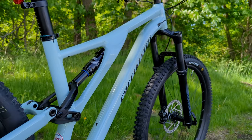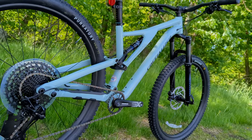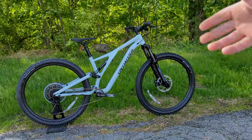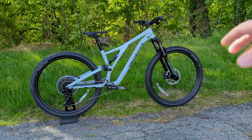That all allows this bike to be a one-quiver choice if you're picking up one mountain bike to do a real varied amount of terrain. With 140mm front and 130mm rear, the bike has enough suspension travel for features and a lot of different trail conditions, but it's still short enough travel to be really playful.